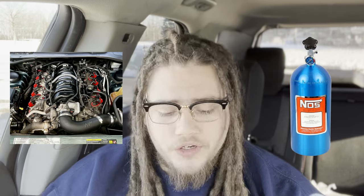Moving on, consider the direction of your build. When doing a camshaft swap, it's best to know exactly where you're going in the build process. If you choose a naturally aspirated camshaft that is not spec'd to run boost, you're not going to be happy throwing a supercharger on later with that NA cam. However, if you get a supercharger cam and you're naturally aspirated for a while, you'll be fine until you throw the supercharger on. You need to consider your goals: how much horsepower, naturally aspirated vs. nitrous vs. forced induction, and also drivability — is this a track toy or a daily driver?